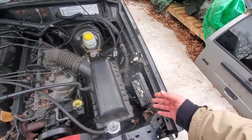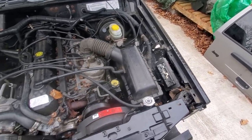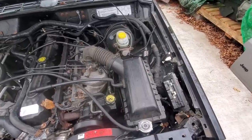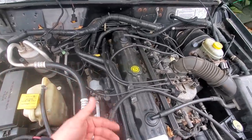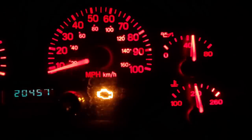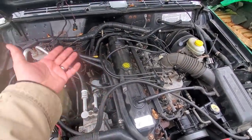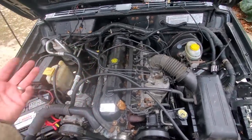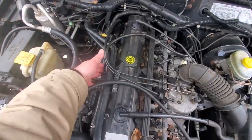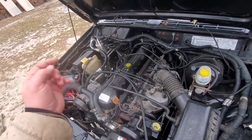I didn't get around to checking this for a couple months. By the time I did, the battery was long dead, and we replaced the battery and we didn't try to start the vehicle. So we didn't actually get a code until way after I already diagnosed that it's probably the crankshaft positioning sensor. Check your codes if you have a check engine light. Of course, you're going to want to make sure you have good spark plugs, but I know one bad spark plug isn't going to make the whole engine not run. Go ahead and change the spark plugs. When you replace the coil rail, if it makes it feel better, it's an easy job - go ahead and do it.